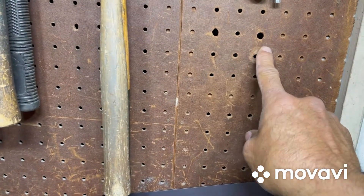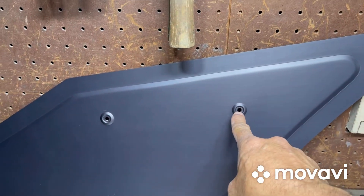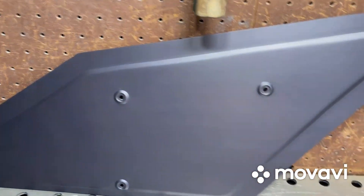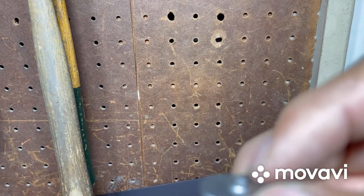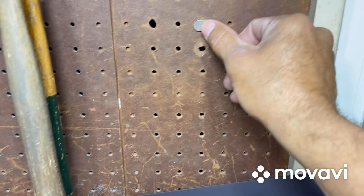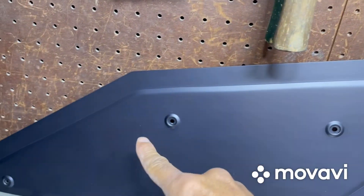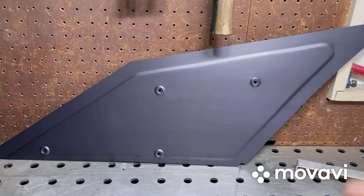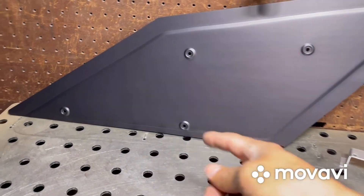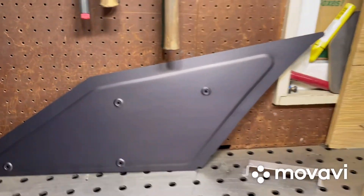The holes the car has are pretty big — about a quarter inch. You can see these weld nuts have a little divot there. To get the bolts right in the center so the heads are nicely centered, I'll use this as an example: the hole is a little bit bigger than the weld nut, so I use the back side, move it all the way forward, and tack it. I go to the second one, do the same thing — move it all the way forward and tack it. Then once I have those two, I'll try it on to see if they line up. By putting tape on the other two holes on the bottom, I can poke it with something to make sure those holes line up before I get committed and weld the weld nuts on. That works out pretty easy.